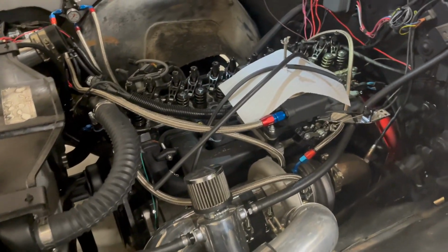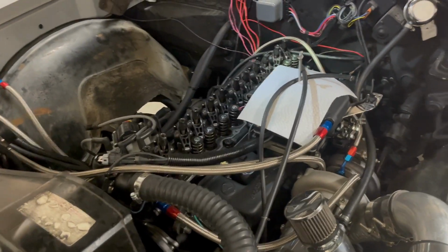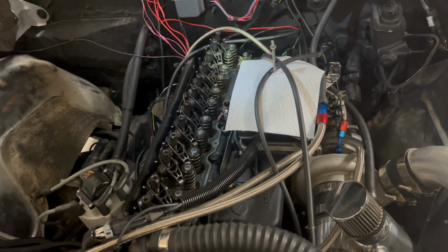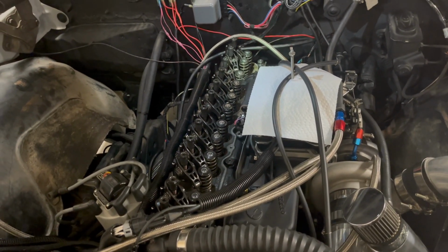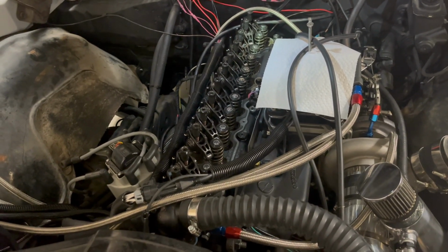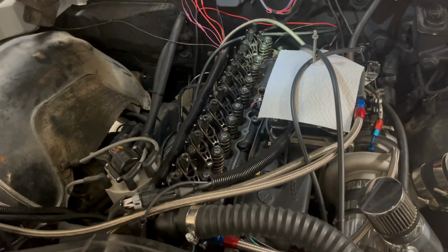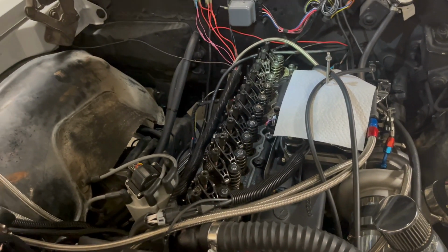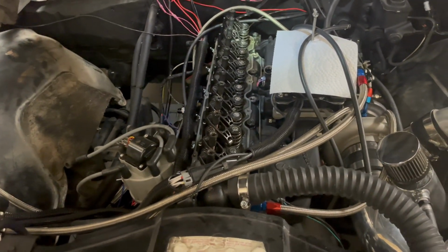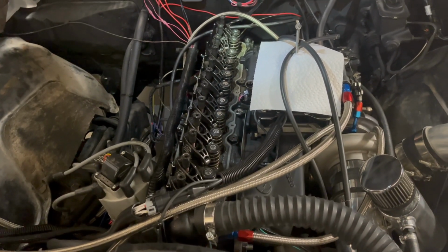But other than that, I'm just kind of at a loss because everything runs great. Those borescope images don't show any wear on the sidewalls like there would be if there was significant piston slap. I went back and checked some of my older videos, and it seems like that sound was either always there or only got slightly worse. But for all I know, it can honestly just be after 1,000 miles on a fresh engine. I might just need to relash the valves. It might just be part of engine break-in.